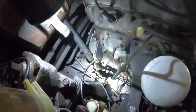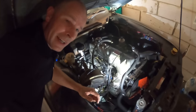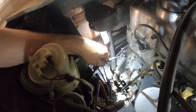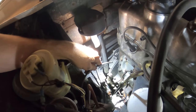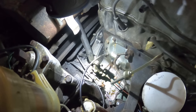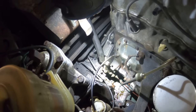Just when things were going really well, I thought I'd better go and double-check everything was alright — I gave this pipe a little wiggle and what do you know, it came out of the olive yet again. So I'm going to have to go and buy a new pipe. The pipe I got was a secondhand section of this particular black plastic fuel line, but it had a different fitting on it — this is the female end and that had the male on it. So what I'm going to have to do is find out where I can buy one of these pipes pre-made, or a new olive and coupling, from somewhere. But at least the car runs — it does start and it drove briefly.